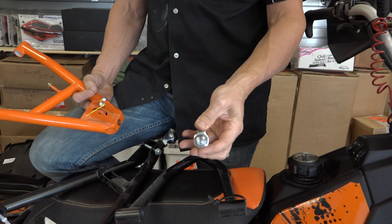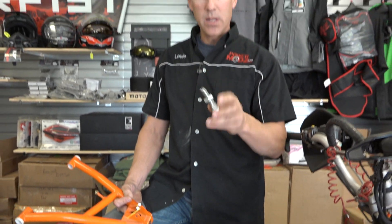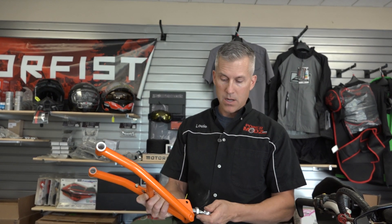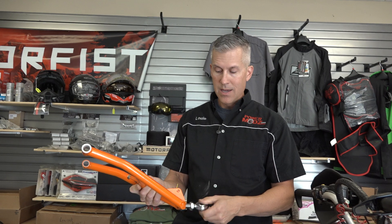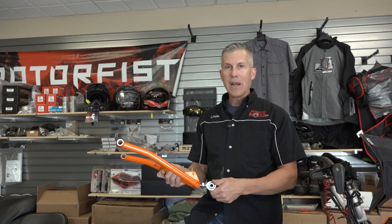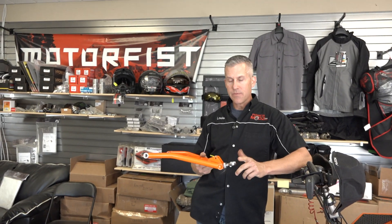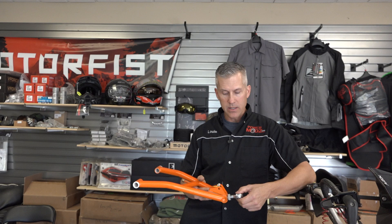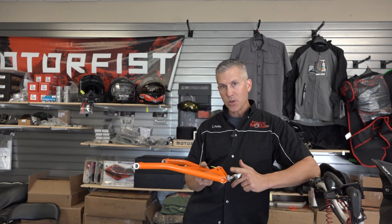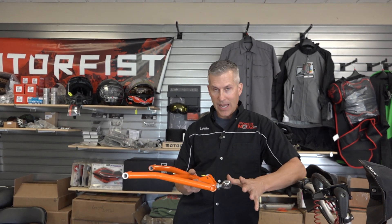There's a little slot cut in the back of this - Dan sent this one already slotted. So if this snaps off, you just go in through the back of the arm with a small screwdriver and spin it out. Out it comes. A high percentage of the time - probably 90%, depending on where you're riding - it's tagging a ski that bends that A-arm. If you tag something hard enough, sometimes this will just sort of bend, giving you a bit of an indication that something's going down and it's time to replace it.